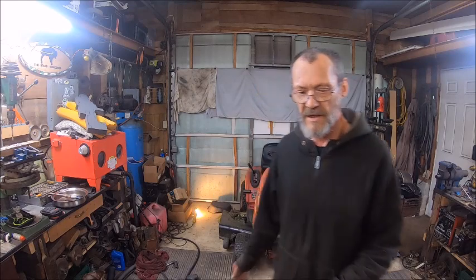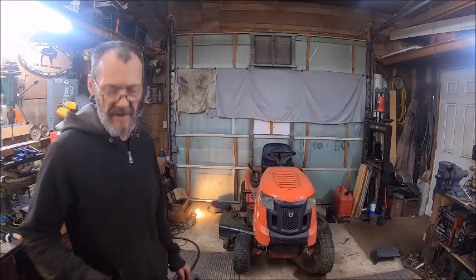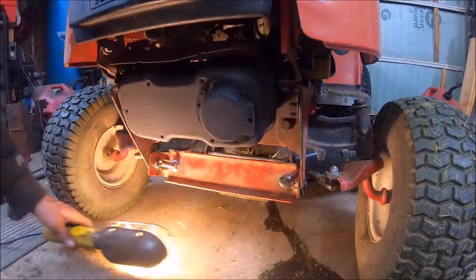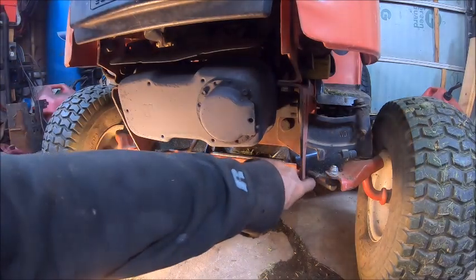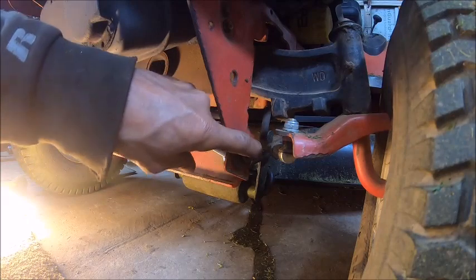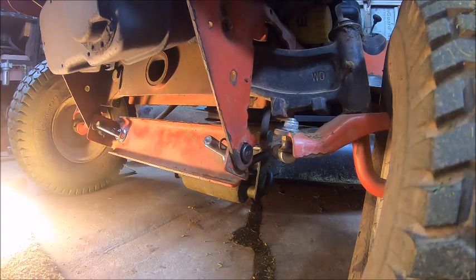The middle blade was bent that far below the bottom of the deck. On the front of this thing I'll go ahead and show you this little upgrade too. These pins here that go into this were just flopping around — there was no stability whatsoever, it had a lot of slap in it. So I went and made a bushing to go in its place.